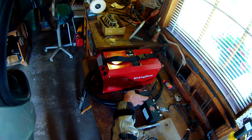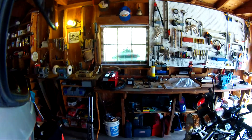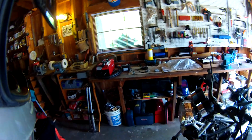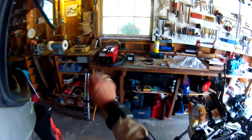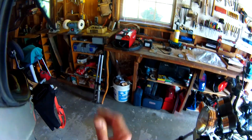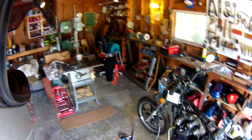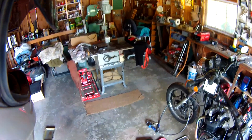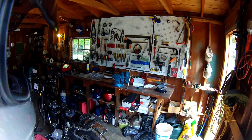It's inverter style rather than transformer, so a little more power for the current I've got — only 14/3 wire and 15 amp. I've only tripped the breaker once, and that was with the wire feed and voltage up to the max. At slightly lower settings it seems fine. Someone told me my first attempts at welding looked like a steel bird pooped on the plate — I thought that was kind of funny. Anyway, take care, catch you on the next one.